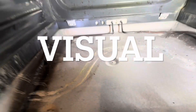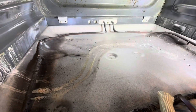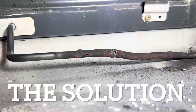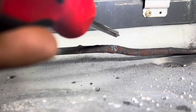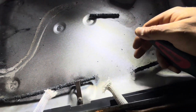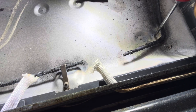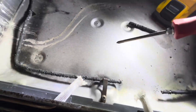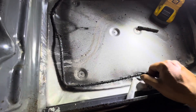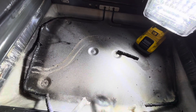Since this is a hidden heating element, I wasn't able to see the actual condition of it, but it has multiple portions where it's swollen and broken. The more I inspect this, the more I'm finding damage. It looks like it arced and got stuck to the bottom of the oven, hitting ground here and here. Yeah, this is pretty bad.